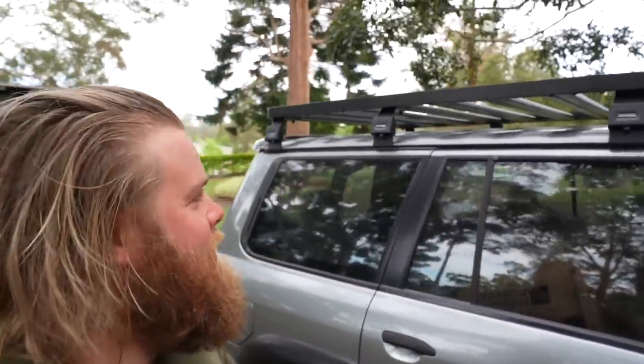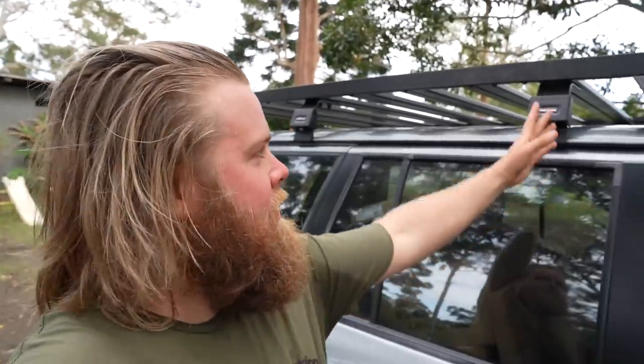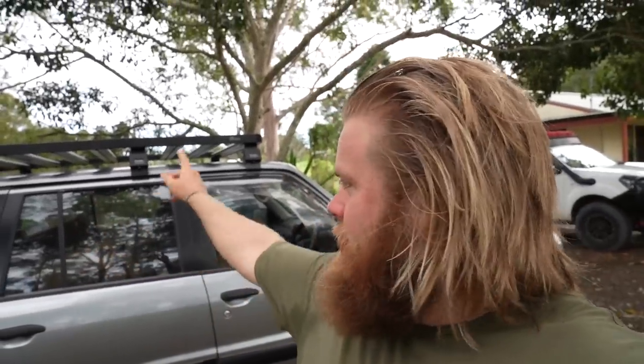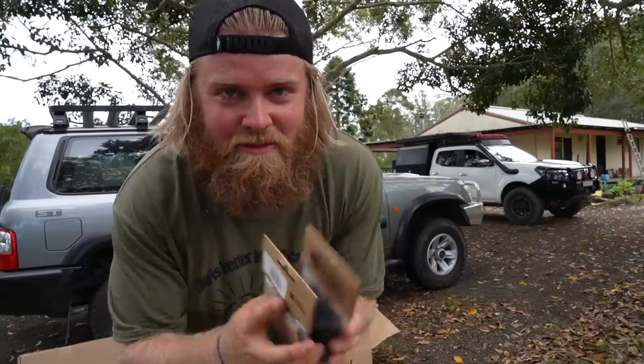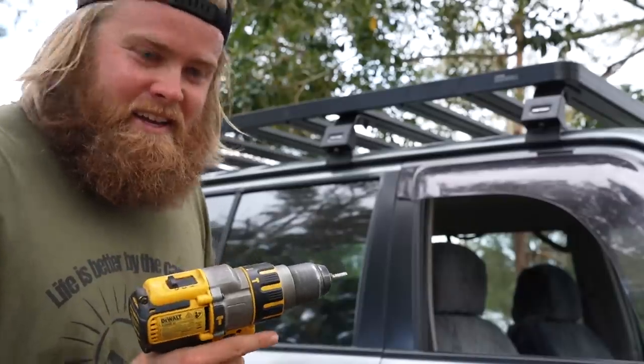Back again the next day to finish off the roof rack. I realized a couple of things I did wrong. Firstly, the instructions didn't clearly say where to mount the legs, but looking online I found a different instruction set showing where that back one is meant to go — I've got to move that. Also, looking it over, I didn't properly jam all of these in — they've got to be pushed right in. And lastly, I spoke to Front Runner last night and they confirmed that somewhere in the other boxes there should be spacers to lift the front and rear up a little so it sits flat. I need to fix those three things and then I can mount the accessories.